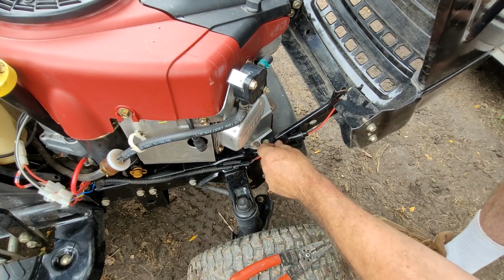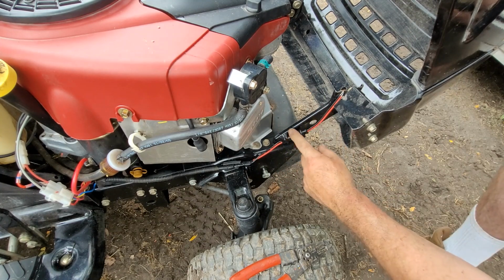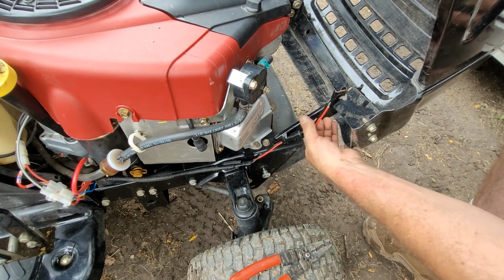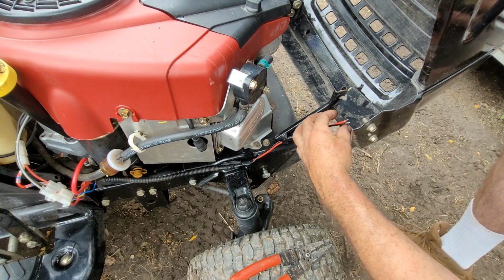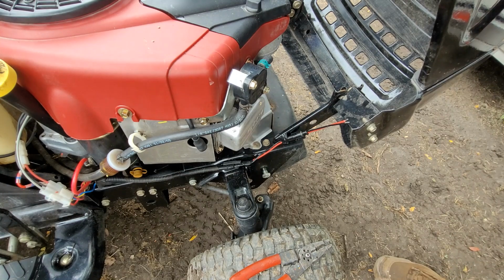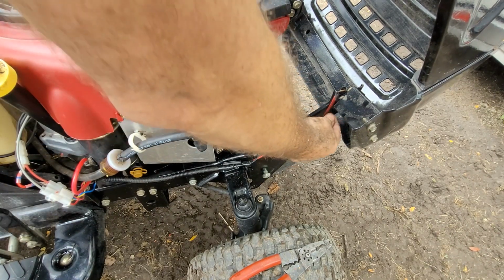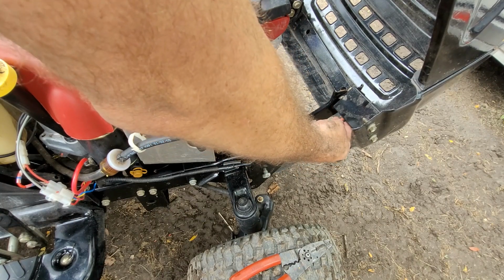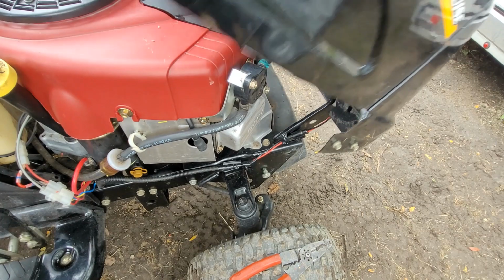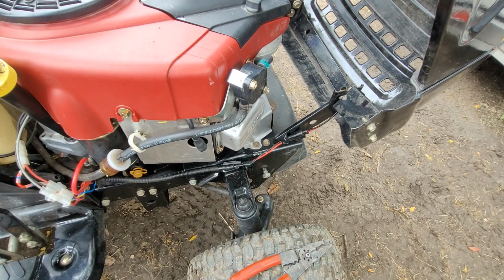There's the muffler. I mean, the air is blowing out, but still, that's hot. That way it'll just keep me the length I want to be. We don't want to pinch the wires in there at all. We want to maybe bring them over there, bring them away from the pivot point. And so bring them back maybe on the inside. Yeah, probably on the inside. That way, when I pull the hood back, they won't come backwards. Yeah, that's what we'll do.